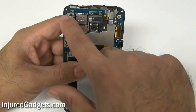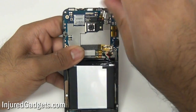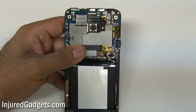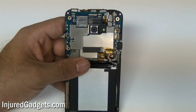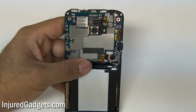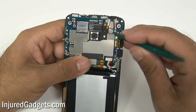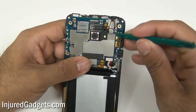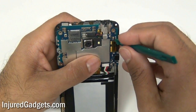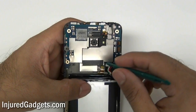Next, go ahead and remove the two Phillips screws on the top of your motherboard. You will notice little yellow heat conductive tape covering some battery terminals or flex cable connectors. You can remove this heat conductive tape — if you lose it, don't worry too much, as it mainly just protects the cables from heat. If you see it covering any flex cables in this video, it's just a little piece of plastic tape and you'll want to remove it.